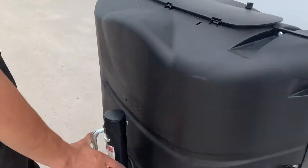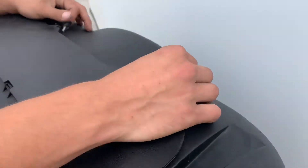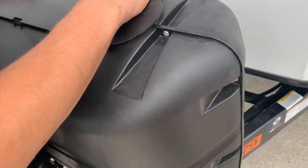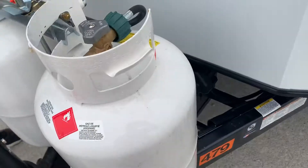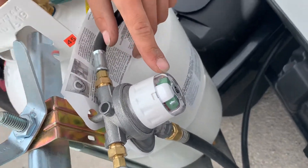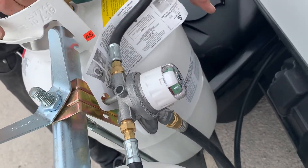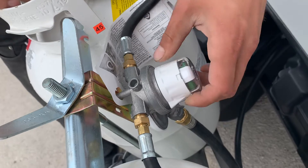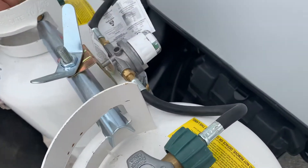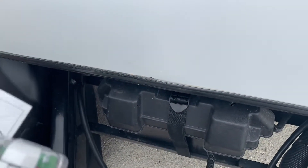The tongue jacks: the way it goes up here, it goes down. Your propane goes over here — the two knobs there, just push those back and you've got access to your valves. You've got your changeover right here. You can see that's currently green, letting you know that propane is in the system and ready to go. If it were to go red, it's letting you know that this tank is now empty. Just take it over and switch it over — that arrow pointing out there indicates the tank you're drawing off. Right back here in this little black box is your battery. As long as you're plugged into that shore cord, that battery is charging for you.